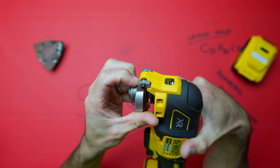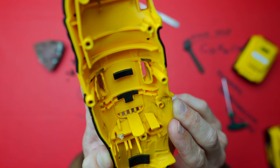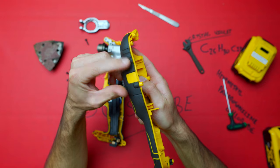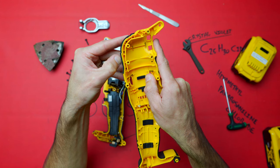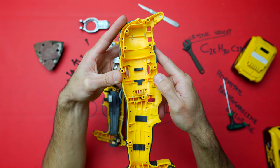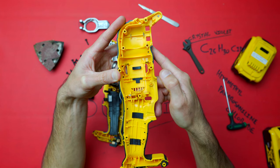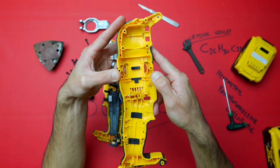The clamshell is made out of PA6 glass fiber reinforced 30% — that is a nylon with a TPE overmolding. The TPE overmolding is this black rubber bit here that's cast over the clamshell, fairly thick and really nice and soft — makes for a nice grip. Not too sure how long it's going to last though, especially if there are chemicals involved. Overall the casing does look fairly new; the mold still looks pretty good — I don't see any machine marks or places where they've had to manually make changes. The two halves just fit together really well.